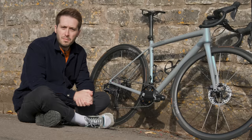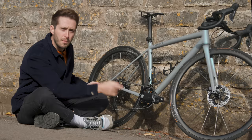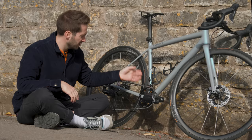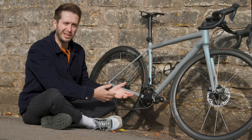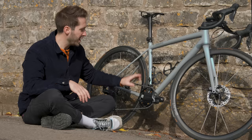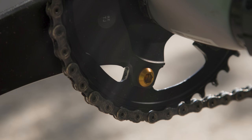Manifesting being good at bikes is all I've really got this season, so I've decided to become Primoz Roglic by using a one-by drivetrain. But to avoid any repeat of his misery in the Giro I've used a chain catcher, so hopefully my chain doesn't come off. I've done all of this purely to save weight — you can get rid of the front derailleur, a chainring, and even run a shorter chain. The chainring is a 40-tooth unit from Wolftooth; it didn't actually fit on these cranks at all so I had to get the file out, but you can barely tell.